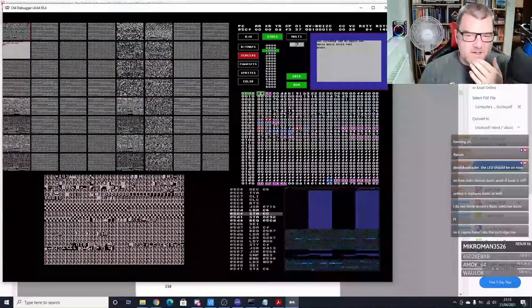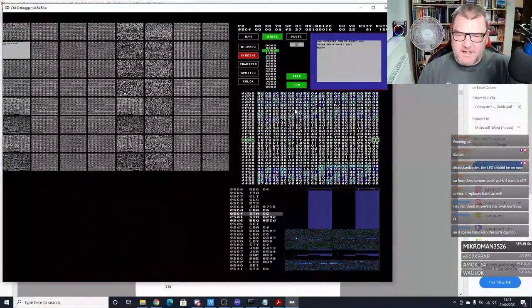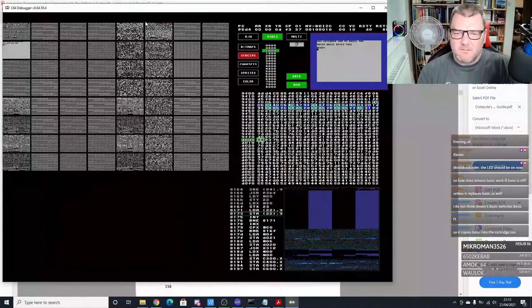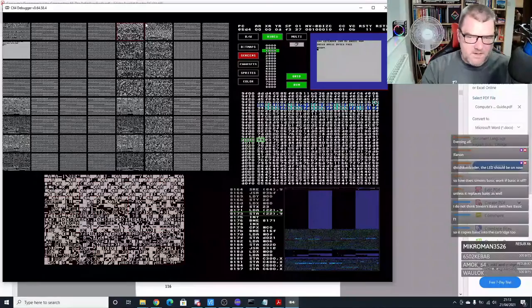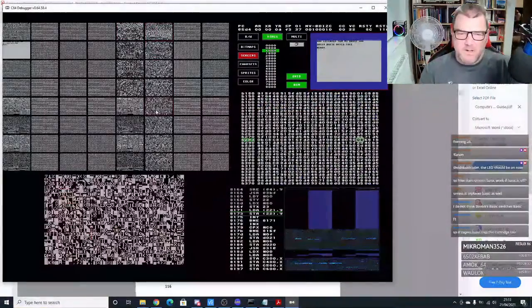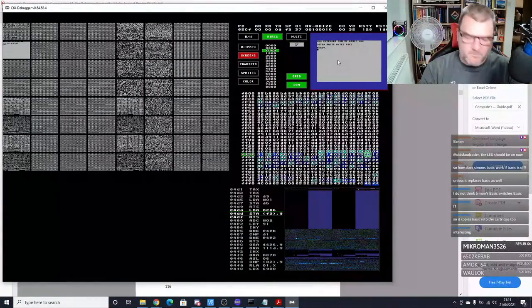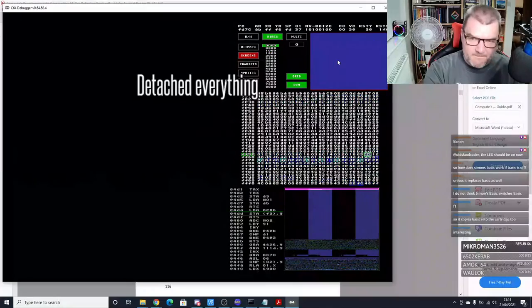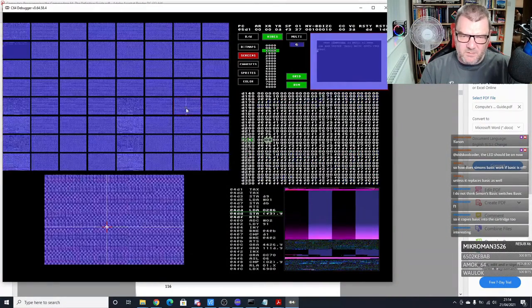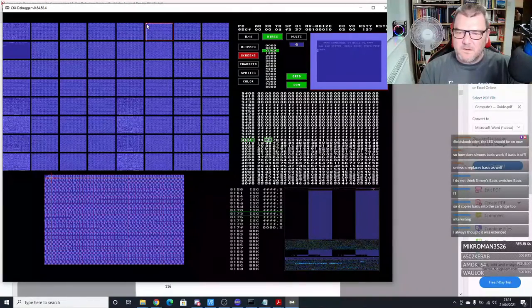I don't think he copies BASIC. I don't think he's copied BASIC. I think he's actually rewrote it. Because the reason why I say that is that here, at 8000, that should have the CBM characters in. And it's not. So I'm just wondering if he's made his own version of BASIC. Let me just detach everything, so it's just gone back into normal mode. Right, so 8000's up here somewhere. You should see that there's a CBM sign up there somewhere.